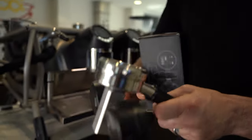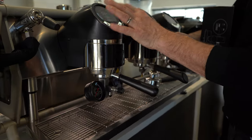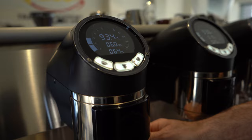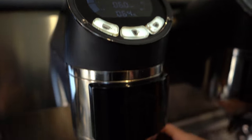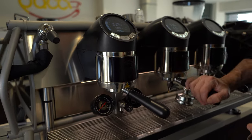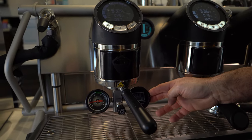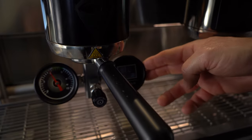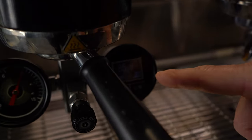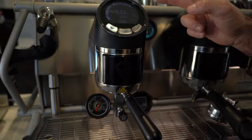So what we're going to do is road test that. I have here 93.4 degrees at the group head. I'm going to turn this on, lock that in at 93.4 degrees, and see what my reading is. This little indicator here will show me exactly what I've got. And we're reading here 85–86 degrees — that's a seven degree difference. That's a huge difference in coffee profile.